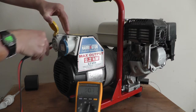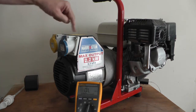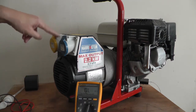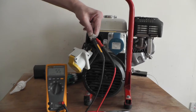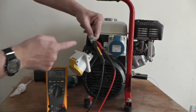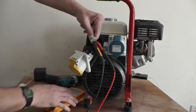So I'll be suspecting the capacitor or the capacitor winding now. To do that I'm going to have to take this plug off. I took that plug socket off, took the wires off the capacitor, and I'm just testing the winding — that's 5.5 ohms.